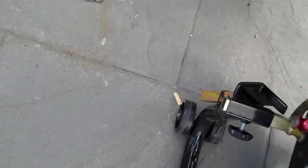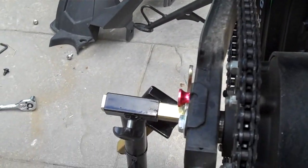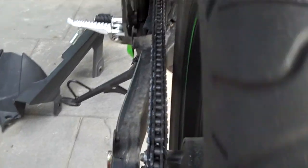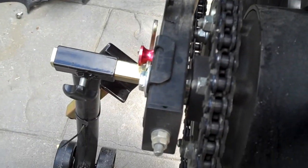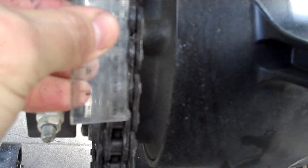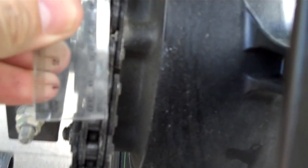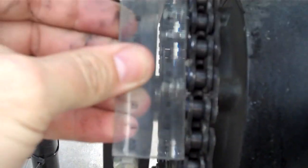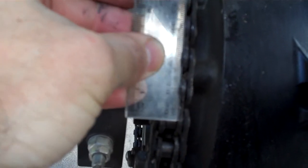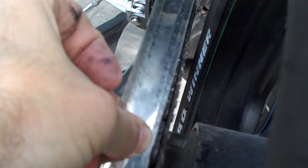Nonetheless, we'll press on. The bike's up on the stand, the bike's in neutral and we can roll the chain forward. Now the best way to check this is grab your ruler and put it up on the inside of the chain. With my fingers I'm actually pushing to the right. So instead of pressing that way, push the ruler up on the inside of the chain while still keeping pressure to the right of the bike, and then roll the wheel forward.